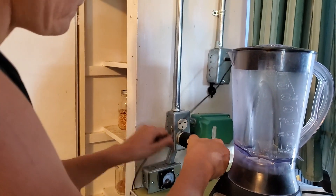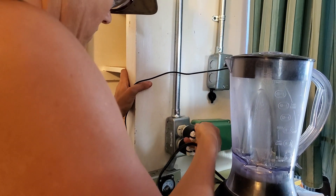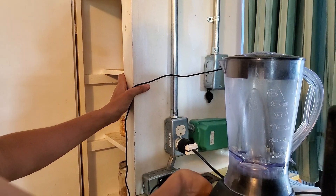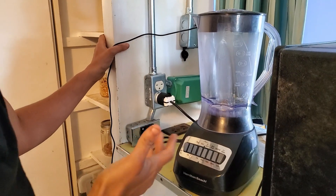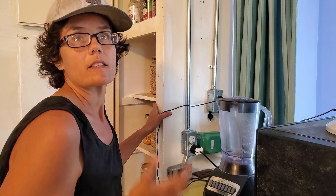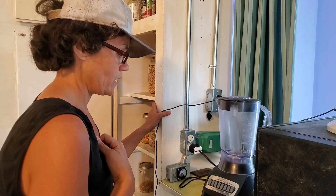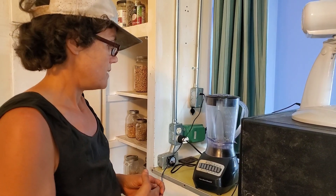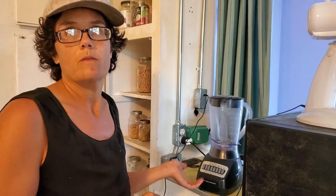This is a converted blender. If you're running it at around 100 volts, you can run appliances made for 120 AC as long as they're converted to handle the arcing of the DC. If the motor can handle direct current, you can put a snubber across the switch and run it solar direct.